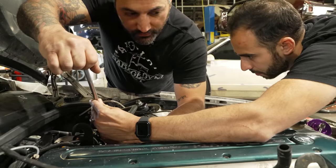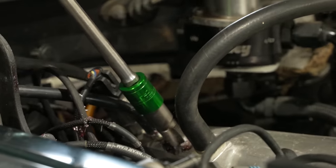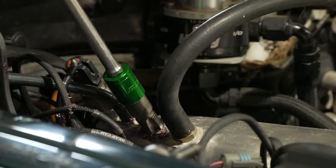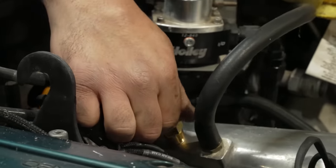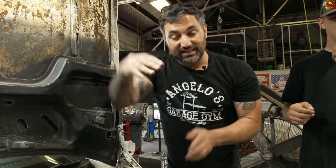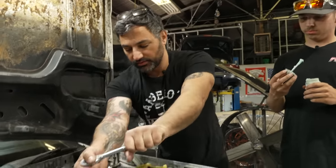Come up a little towards you. Put in, this is a pipe tap, 3/8 NPT. That means national pipe thread. Pipe thread refers to something that's a taper. As it gets threaded in, it gets wider. A little bit of tape or pipe dope on the thread, and it essentially just wedges itself in there.